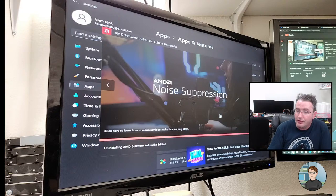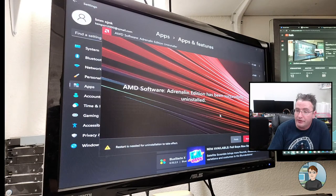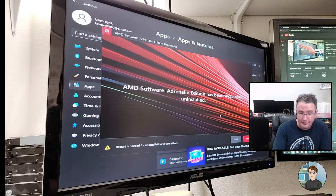So Zulu says Acer Nitro 5 laptop is supposed to have a GTX 1050 Ti in it. Well, I can confirm that they could have multiple different SKUs with that name. Let's see. I went to Device Manager. It is a GTX 1650 Ti in this one. Processor is a Core i5-10300H. So 4-core with hyper-threading.